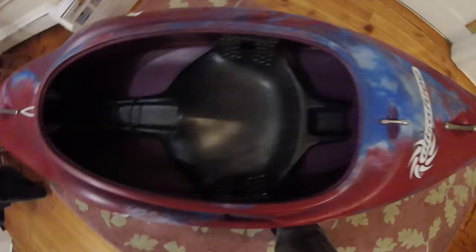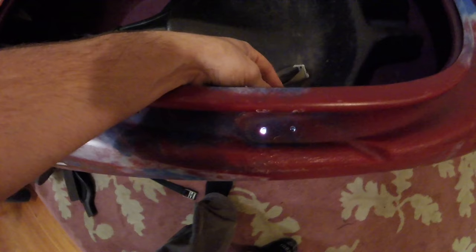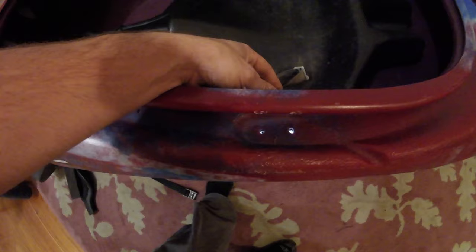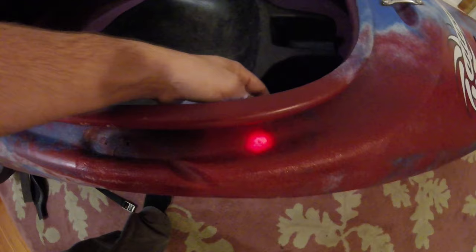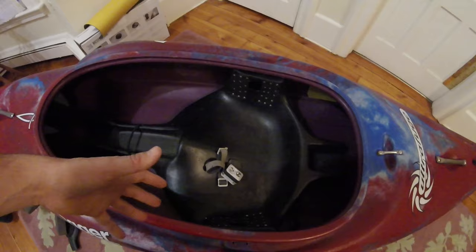This one is a Piranha, and this boat came to me in pieces from a guy who never finished converting it to seat one, so I've got to make one from scrap metal. When I throw a flashlight inside this boat, you can see that light comes out of the two holes, but there's no other part of the boat that's lighting up. If I throw it under another piece of plastic, you can see the flashlight come right through. That tells me there's no track carved into the seat — we're going to carve a track in.